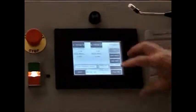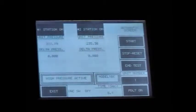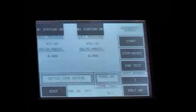Close the hood, pressing reset and start. The preset for the leak in this particular model is half a pound, 0.5 pounds. We have a 45 second stabilization time and a 25 second test time at the end of the stabilization period. We're 20 seconds into our stabilization time.